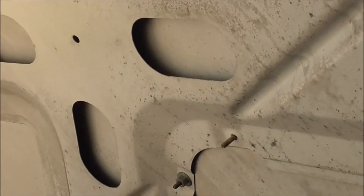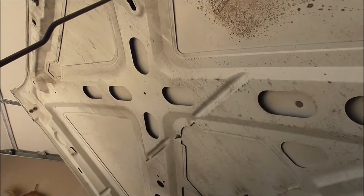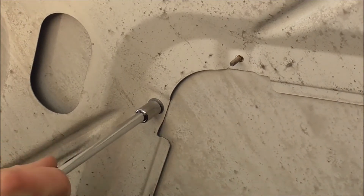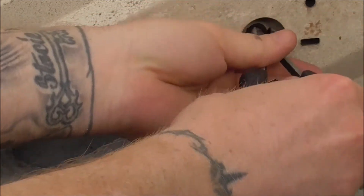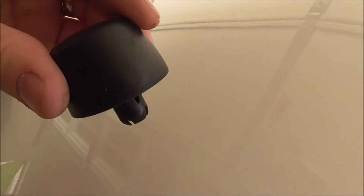You've got to take these off to access the stuff behind it. This is just a little rubber bump that goes right there normally. Take a pair of pliers, see the two ends that stick out — pinch those together and it comes out. In the middle you typically have two nuts. The book says eight millimeter but I used a nine millimeter — that's the one that fit mine. Going to take that one off and then that should release the little loop at the top.